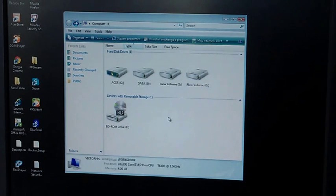If you don't see both the source and destination drives, right-click your My Computer folder and select Manage. Under the storage tab, click Disk Management. Locate your destination hard drive, right-click, select Online, and your drive letter will now be activated.